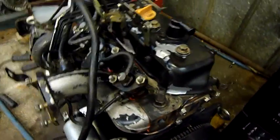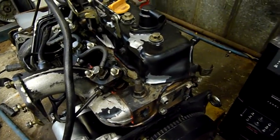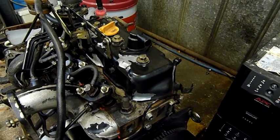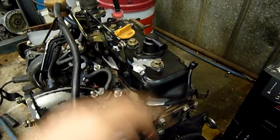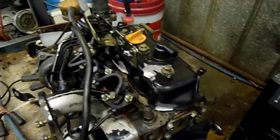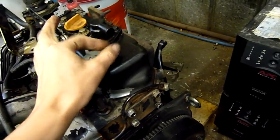G'day folks. This video is for those of you who were wondering how to set the valve lash on one of these engines. It's very similar to a lot of push rod engines which have solid lifters. Generally if it's a hydraulic lifter engine like the V8 that I just stripped down, it won't have any kind of adjusting screw on them, because the hydraulic compression inside the lifter once oil pressure is up will compensate for that — once they're full of oil they compress to a set tolerance. So hydraulic lifter engines you don't have to worry about it generally, but these ones you do.